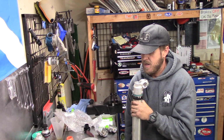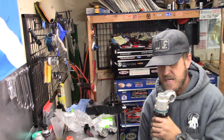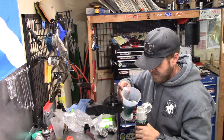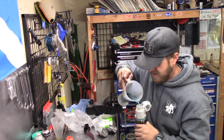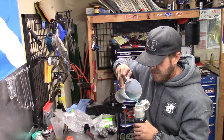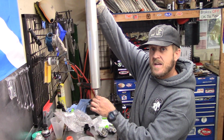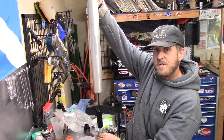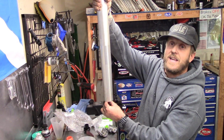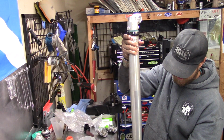Keep an eye on it so it doesn't go too much. But if you're doing this yourself, you'll see it will slowly go down. You'll see bubbles coming up. We're going to get all 500 cc's in from this end. And as you pour it in there, like I said, just take this. You're going to pull down nice and slow. If you pull too hard, it's going to pull it out and all the oil is going to go everywhere. So don't reach up in here and yank down really hard, because it will pull the cartridge right out and oil will go everywhere. You pull it down nice and slow.